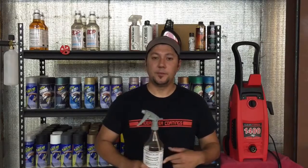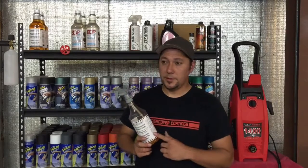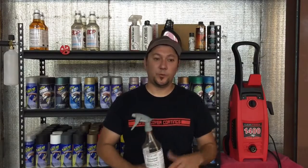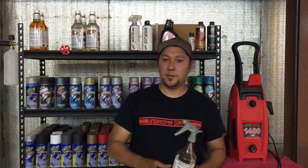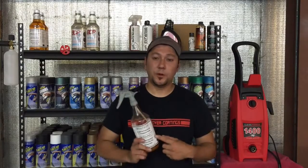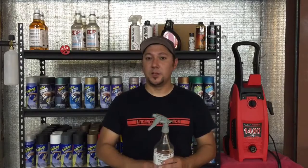Now that you've seen the process, I wanted to close out with a recap and some things to consider. First, five to ten minutes in between coats — you want to do about two coats, and most importantly you want to test before you move on to the pressure washer. If the dip is not liquefied it's not going to work, so test it. You may have seen the little zigzags I made on the roof in the time lapse — I was just testing to make sure the panel was liquefied before moving on. Second thing to consider is your surroundings: you don't want a dipped vehicle nearby when applying or removing it, because you're going to have liquefied dip pieces flying around and you don't want that getting stuck into somebody else's vehicle.